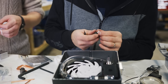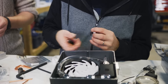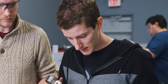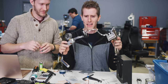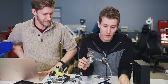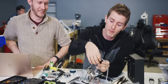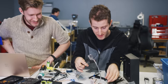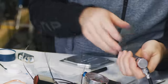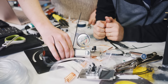Because these fittings for the inside of the camera are so small, there's nowhere they could really put an O-ring seal on them. So instead, we're using Teflon tape to seal up the threads. Because we don't actually have a quick and easy way to leak test our blocks, we took one of those five-way manifolds, plugged four of them, connected the last one to the block, plugged the end with vice grips, and now we can hook up our EK leak tester to pressurize the loop and see if our block leaks.